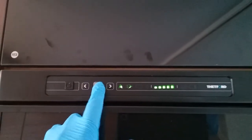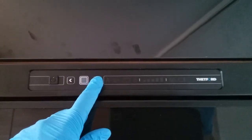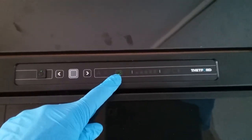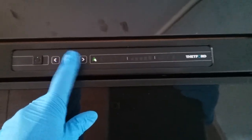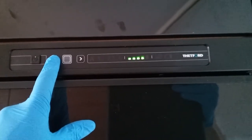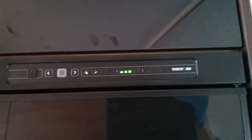All we do is hold down the grey button just here. It will begin to flash, and then we just use the arrow keys to pick. So we can manually put it onto mains, or 12 volt maintain, or gas. But auto is the easiest one to have it on. Once we've selected this, it will then go across to the temperature control, and again just use your arrows, press finally, and there we are.